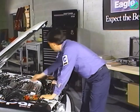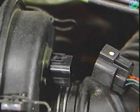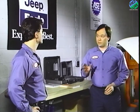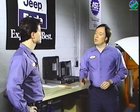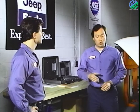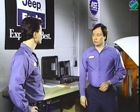I'll disconnect an injector, and the barometric, intake air temperature, and airflow sensors. Now I've got to start the car up and wait a minute for the faults to register. Some of the faults are a little slower to register than others. Also, the EGR temperature sensor on California vehicles and the O2 sensor require a multiple startup, and the vehicle needs to be driven before the speed sensor will register a fault.